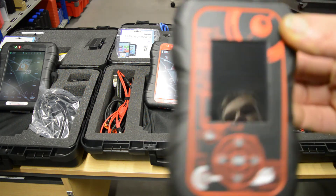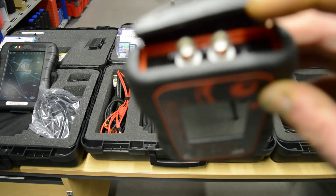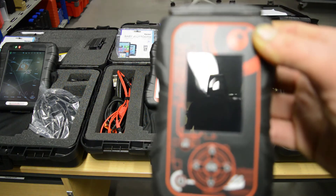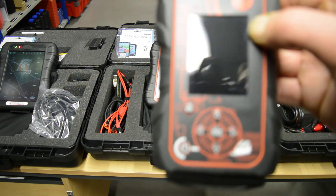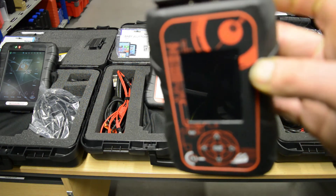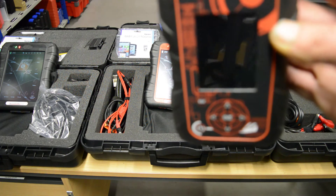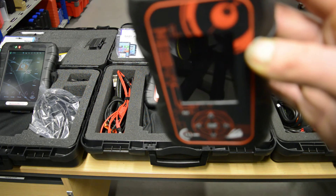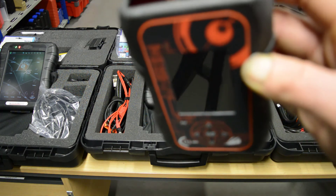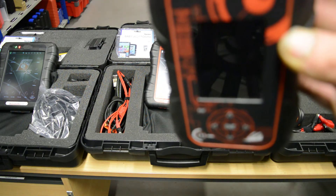Then you have the Socio 400, which is the next model up. As you can see, it's very similar to the X3. The main difference is it has a built-in two-channel oscilloscope and multimeter. It has its own display screen as well, so if you want you can use the scope directly on this without going through the PC, and you can use the multimeter on this screen. When using it through the PC, you can view scope data and diagnostic data on the same screen — instead of having a separate oscilloscope and a separate diagnostic tool, it's all combined into one tool and one software.